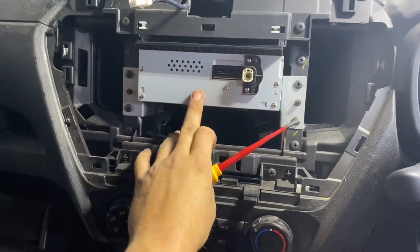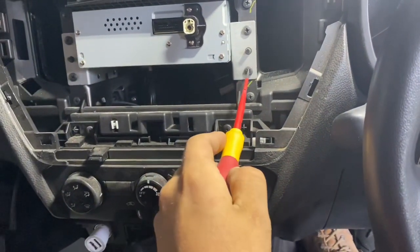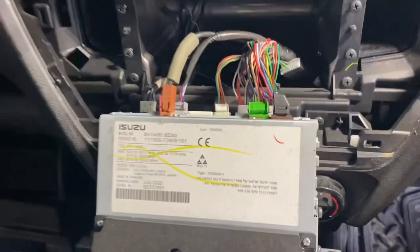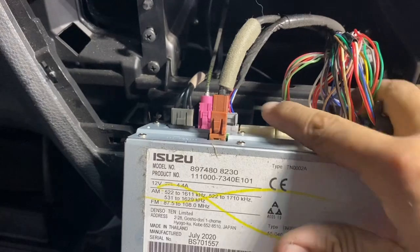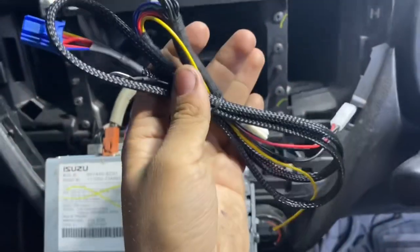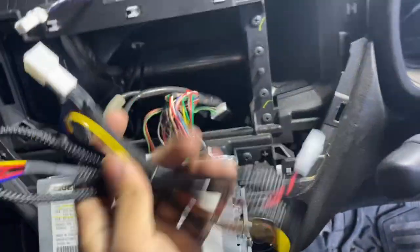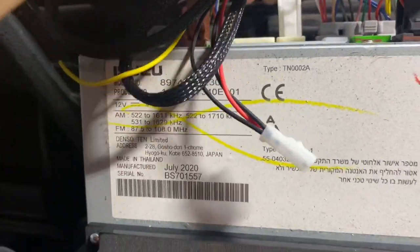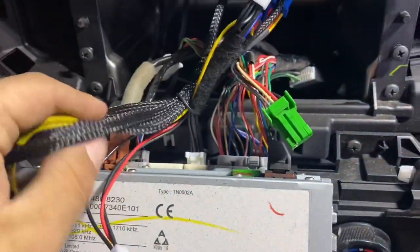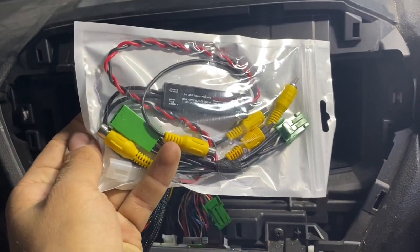Next, take the actual control module out - just those four Phillips heads and it should be sweet. Once we've got our box out, you want to take this green one out and this white one here so I can start installing our patch cables. It's just this one here with the braided sheathing on it. Then put the identical one of the white back in on that patch cable, and then get the green one and do the same thing with the green plug you pulled out.